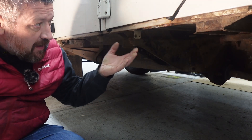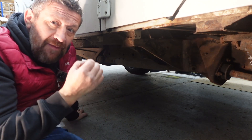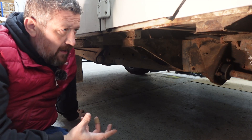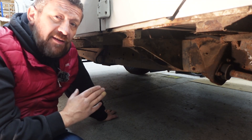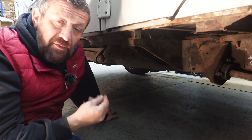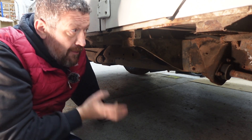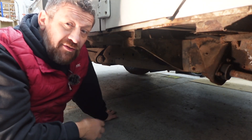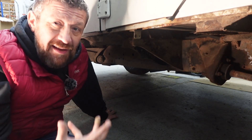So how hard is it to fit them? The reason this looks a little bit different is because I've actually removed the side seals. I did that because I had to get access to the bolts to remove the old side steps, and they were really hard work. So if you're going to be removing any kind of step — whether it's a folding old folding style side step or the side runners, whatever you've got on your vehicle — the easiest thing to do is take these seals off. I was really lucky: the front two folding steps on our 110 did unbolt. I put a lot of penetrating oil on there and let it penetrate for over a day. The front ones came off okay. The back ones I needed to use some vice grips to hold some of the blistered nuts, and in the end one of them had to be cut off because I just literally couldn't get it off. So once they're all in place and bolted in, we can then fit our side seals afterwards — it's a much easier way of doing it.